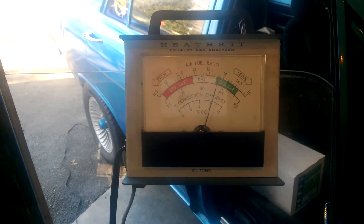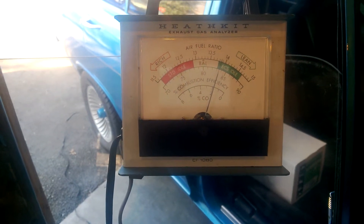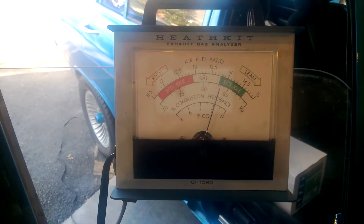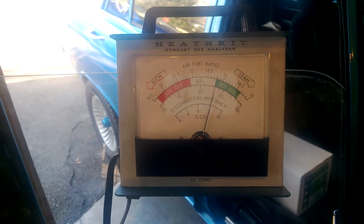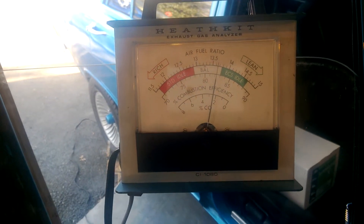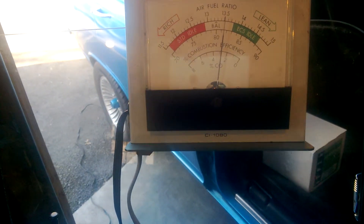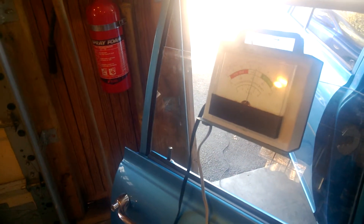So what we've got here looks like it's going down a little bit more. This is the BMW airflow meter, unadjusted as far as the spring — I have not messed with the spring at all. All I've done is adjust out the airflow meter adjustment screw itself. It keeps bouncing back a little bit; that could just be the wind outside affecting my airflow meter, or my gas analyzer — it does that sometimes. Or I turned it back in a little too much too soon.